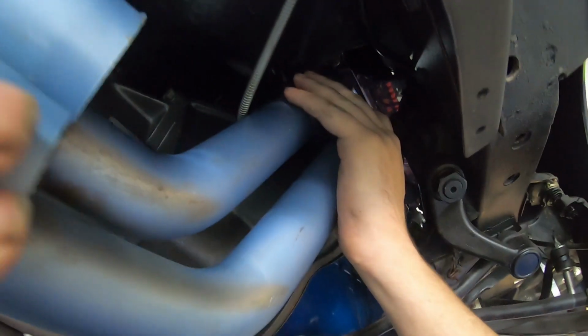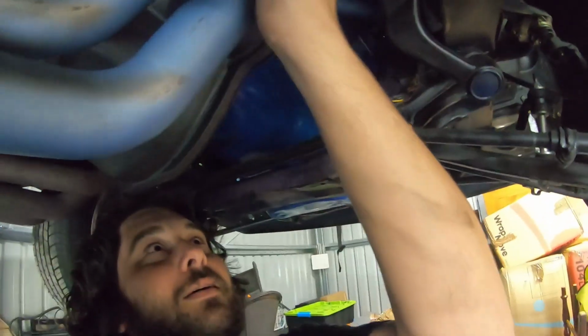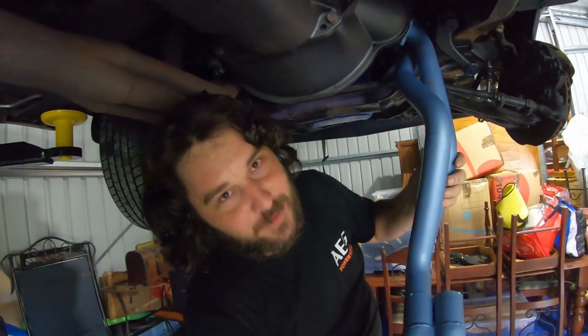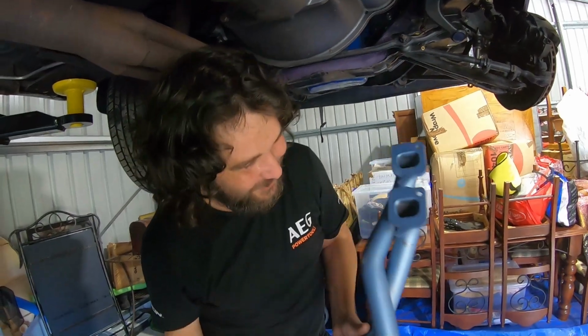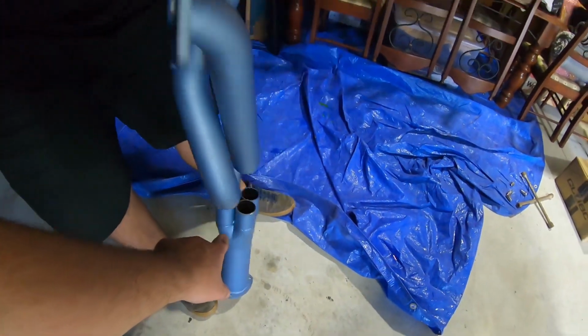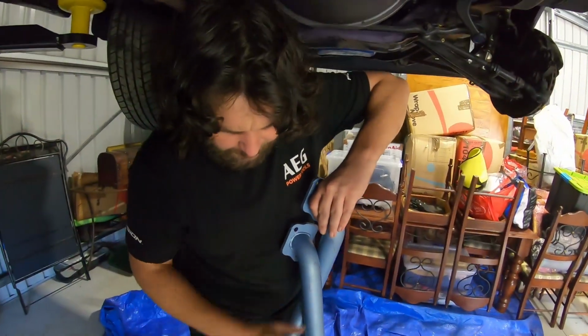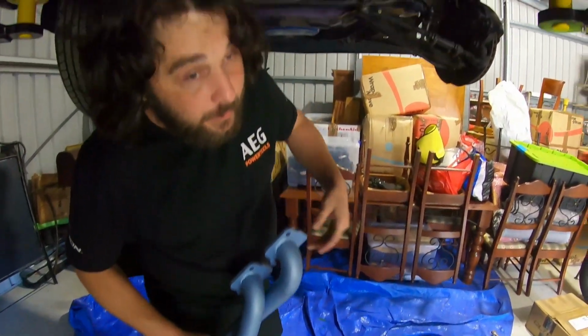Yeah, mate, if there was a gasket there, she's on and she's in. Oh, sweet. Okay. Awesome. So that's a half-fitted extractor. I'm just going to go and get the other 50% of it that's out there on the floor. We'll clean up these holes and smooth them. Absolutely. Wire brush in there. Give them an angle grinder on the end of the pipe so that they slip in and out. We want them to slip in and out before we get into that.